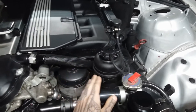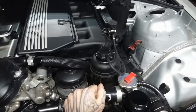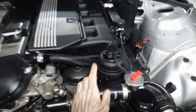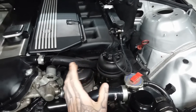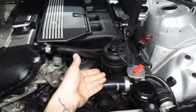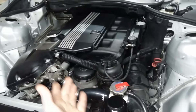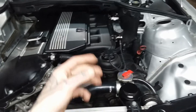The reason for relocating it is that throughout multiple BMWs you usually see this thing coated with ATF or power steering fluid — for two reasons. One is fluid expansion from heat; there's also a weep hole in the cap, so fluid just goes everywhere and makes a huge mess. The second reason is people who don't service their reservoir and replace it, because there's actually a built-in filter in here from the factory. Whenever they get gunked up, it doesn't flow well — it gets backed up, begins expanding, and comes out of the weep hole. So I've sourced my own fitting and installed it into the cap with some hose, so if I do have any issues with fluid expansion it will be contained and won't make a mess everywhere.